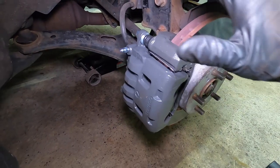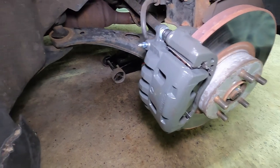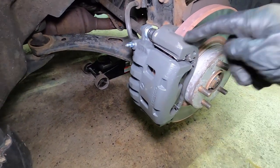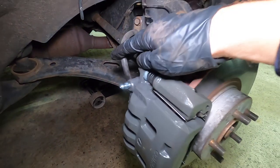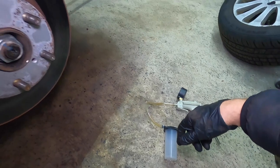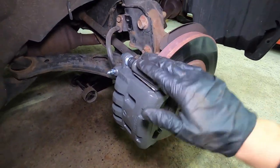Whoops. And now we have the new caliper reinstalled. The cost for the caliper really is not too bad, just $70. And not only do you have the caliper, a bracket, new clips for the brake pads, as well as a new banjo fastener for the brake hose. At this point, we just need to bleed the brakes. I've shown this before on camera. If you're curious on how to do that, I will include a link below and we'll wrap it up.